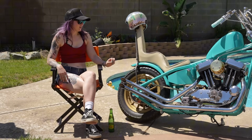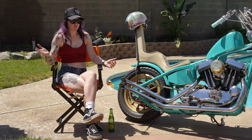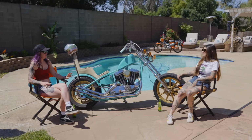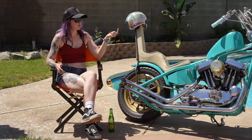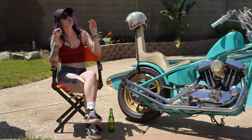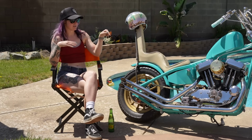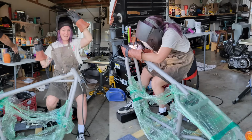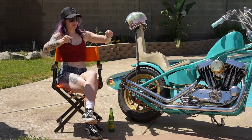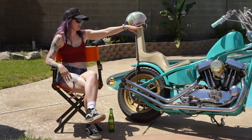But so there's that, and then I really wanted the things that were outside of my wheelhouse to bring in my local people. So Jake doing the frame, Jason being a really good friend, but also a fantastic fabricator in his own right. He did the forks, he made these grips, he helped me make these handlebars. We actually welded these on, he would bring his welder over and haul everything up here, and I welded the tank bungs in, and he taught me how to TIG weld. Then we did these bars in pieces, and I sat on the bike and put them where I want them, and then tacked them all together, and then we welded them. So that was really interesting and fun. It has a fidget spinner on it.